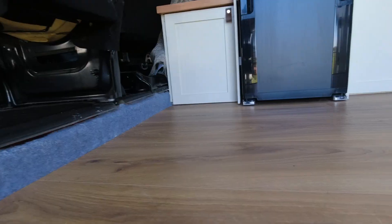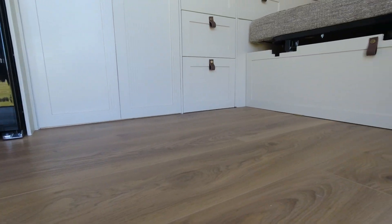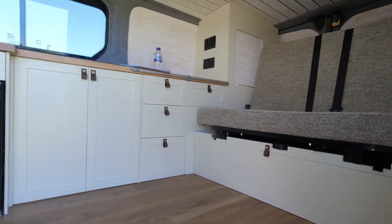After completing that, the next thing I moved on to was the insulation. The van is very well insulated — I think it's 50mm shredded bottles in all of the panels, a little bit thinner material on the ceiling, same type of stuff though. For the floor, I went for a closed-cell foam which is sticky-back, stuck down to the floor. Then we have a sub-floor which is 11mm OSB 3, a moisture-resistant OSB. And on top of that we have the laminate flooring, which is a medium oak.